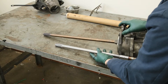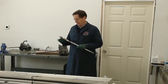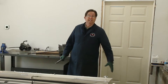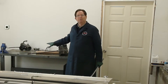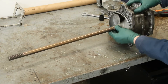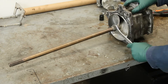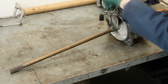You'd think all you have to do is take this drive shaft out and put the new one in. I got on the internet and saw a bunch of videos — guys complaining how hard this is. One guy broke his vice, another said good luck and just had to take it somewhere. We hammered away and finally got the old impeller off. Most people dealing with this are just changing their impeller. There's a nut on the forward section of the impeller — 27 millimeter or one and one-sixteenth — and the threads are reverse left-hand threads. You have to be careful: we're going to be pretending like we're tightening it in order to get it off.